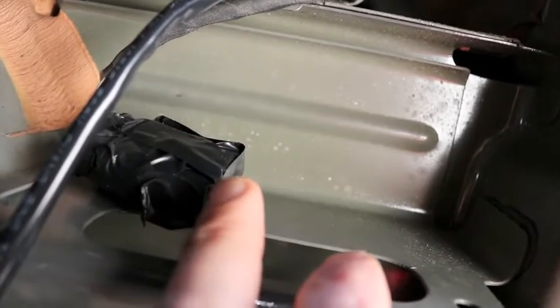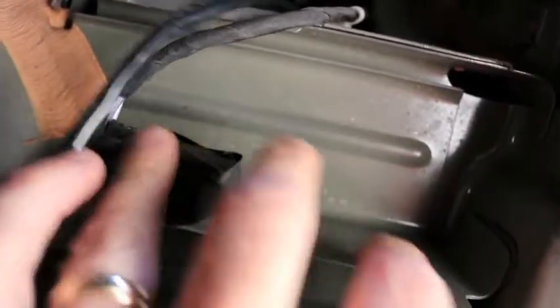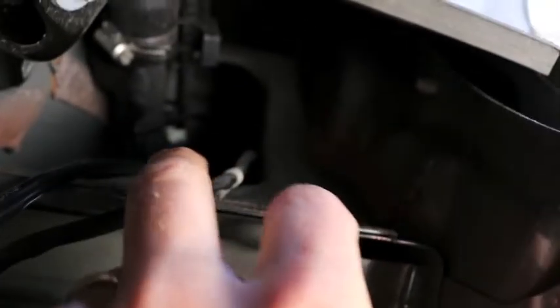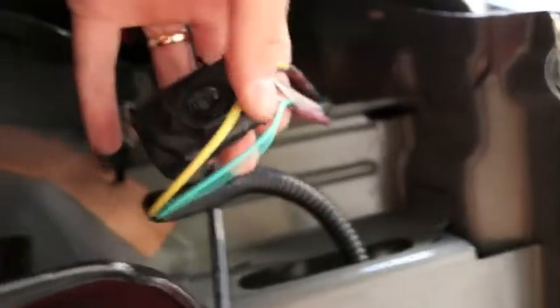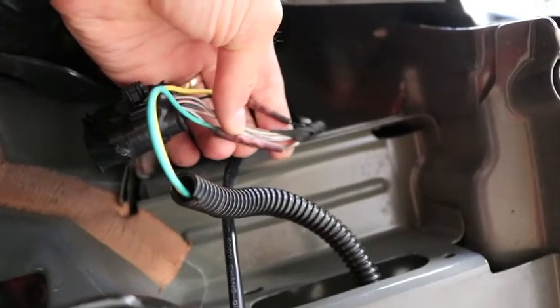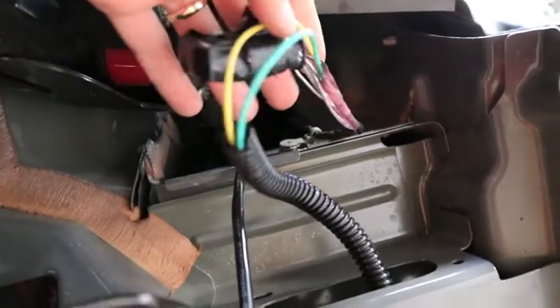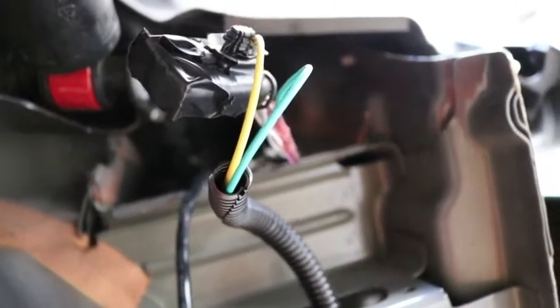I've already taped it up because the sensors and stock license plate light were not connected to this — it's part of the plastic bumper — so I just covered that up to keep some debris off of it. I believe I'm going to want the white and royal blue wire in this bundle. I'm going to disconnect this adapter from the Jeep, take off this little tab to give me some more room to work, cut the sheathing, and get to the wire I need to splice in. I got everything wired up: the green wire is my positive coming from the license plate lights into the white with royal blue from the Jeep, and the yellow is my ground coming into the ground. I'm going to get these things buttoned up down here to make it neater and tuck it all into this little hole and secure it up there to keep it out of harm's way.